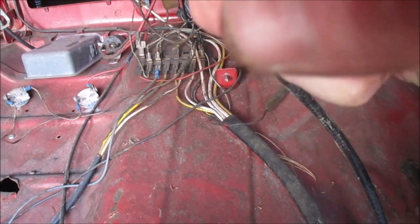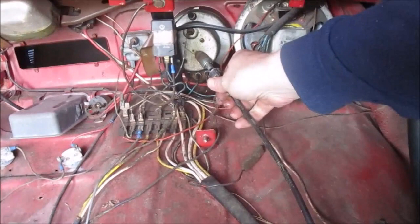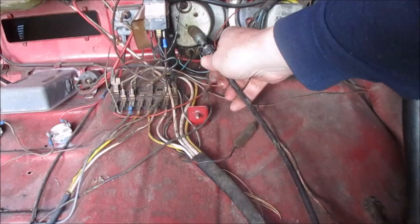All right, so we came back down through the grommet and through the clip on the body, and then came around and went through the spindle and popped out with our little nipple right there in our hub. So since this is a used cable but a good cable, I'm gonna shoot my favorite, whatever your favorite lubricant is. I'm gonna use Fluid Film because that's what I have handy. Right down that cable, then we're going to connect that cable right there to the back of the speedometer, put the dust cap on, put the C-clip on, and give her a spin, see what happens.